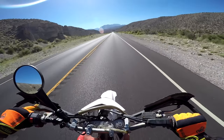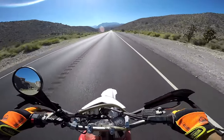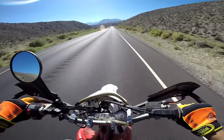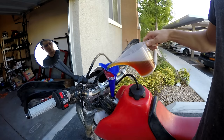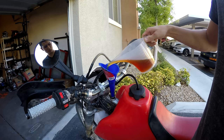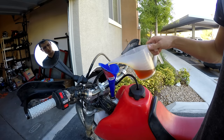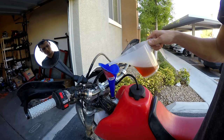The highest speed I've been able to eke out of my XR was 85 mph on a highway, though these kinds of numbers don't matter very much on this type of bike. What really matters is how usable and broad the power is in the dirt, and the XR really does well in that aspect. The dry sump lubrication system uses the frame's front down tube as an oil reservoir. This system allows a large oil capacity without having extra dead space in the crank cases, and it also puts the frame to work as an oil cooler.